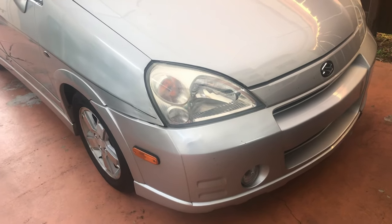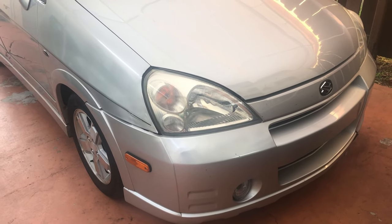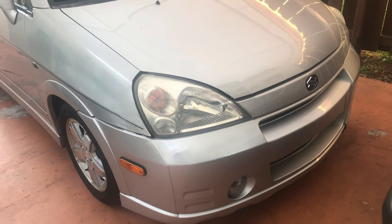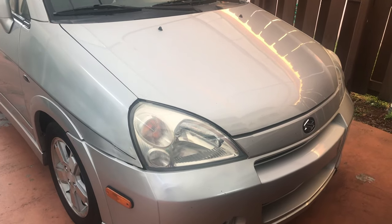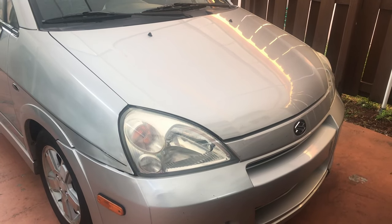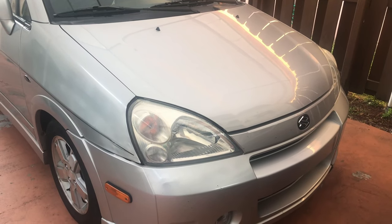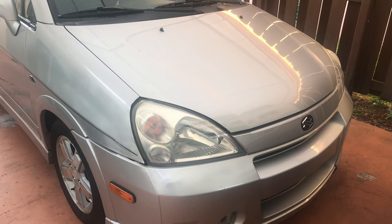Here's the deal — it doesn't matter what car it is. This is a Suzuki Aerio SX, a 2003. I took it to one of the better transmission places I can trust for a good opinion, and they told me that the TCM and ECM are not making any communication, and said there was a ground issue.